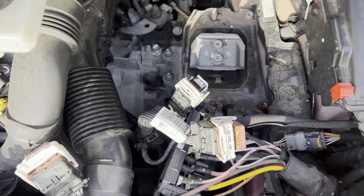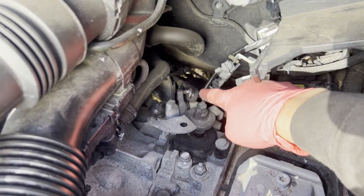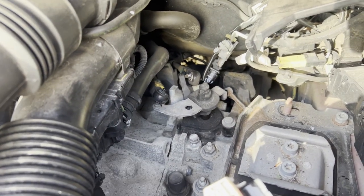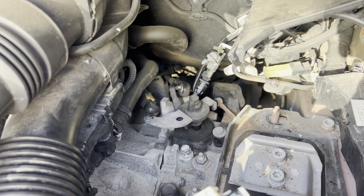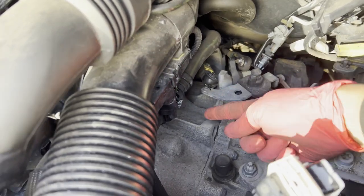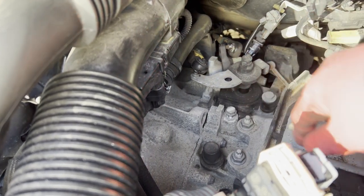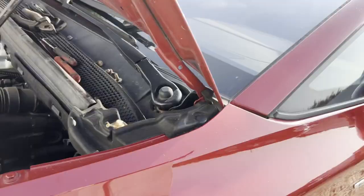Everything is free now - you can see right there the gear linkage is off. There is a T25 up top I have to remove so I can completely lift it up. I'm going to see if there is any slack on those - if I don't have to remove it, I won't, so I can just easily letterbox it. The bolts here I'm going to remove after we've brought the gearbox down because I think it'll be easier to target it from the side. Apart from that, there's nothing else - we're going to move down below now.